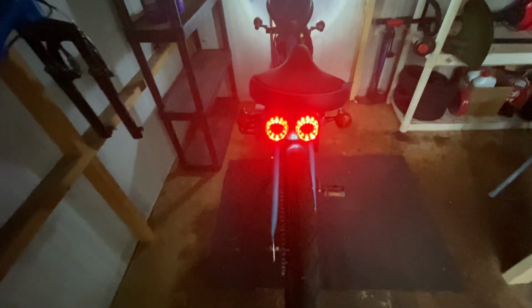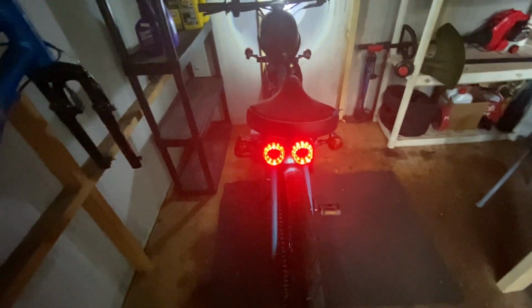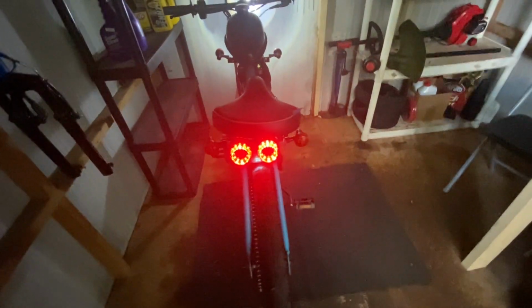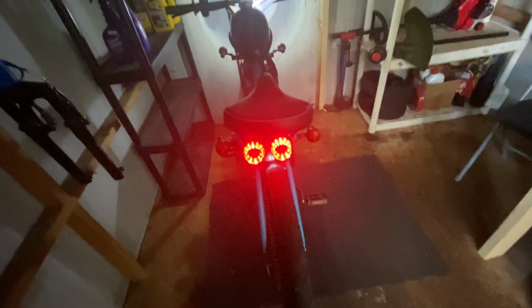Now, if these teeth were pushed to one side or the other of the chain, then you would know right away that it's not centered. It is off by a ton. And that's exactly how you tell whether or not you've got good chain alignment. That's it. That's all. As for the most controversial topic on motorized bikes, even motorcycle guys all say the same thing: if you can, don't run a chain tensioner.